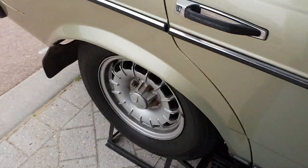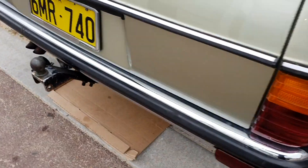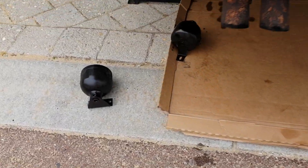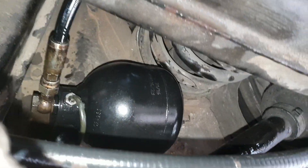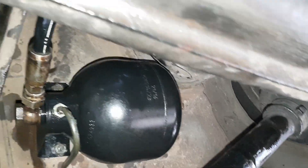At this point I've replaced both accumulators, which has taken me probably about an hour and a half working on car stands. It'd be a lot quicker doing this another time around. Getting the accumulators off is actually a little more time-demanding than putting them back on, and it's actually a little bit easier to disconnect those 11 millimeter fluid lines sometimes with the accumulators already released — which I determined afterwards.